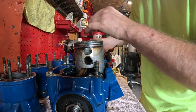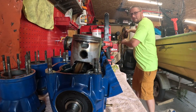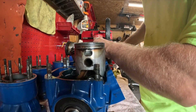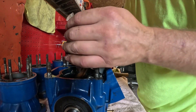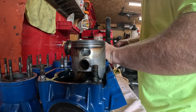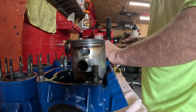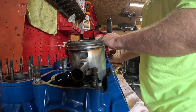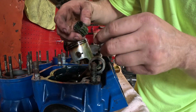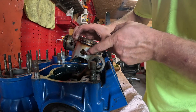You might have to gently tap on them - don't be bending your rods up. You gotta kind of work at them, they will come out. A little leather hammer is good for this. Don't go too aggressive - don't bend your rod, just work it out of there. The extension worked really good on this one guys - there you go, it'll come out. This piston's junk anyway. And then right here is your connecting rod bearing - your rod bearing. I'll show you when we reassemble everything exactly how I do it. These are called wrist pin clips, then I'll show you how we get the crank out.